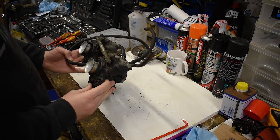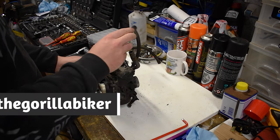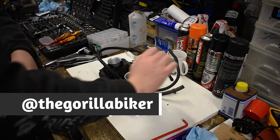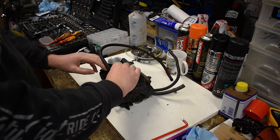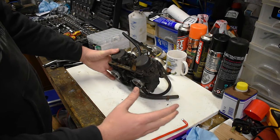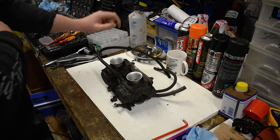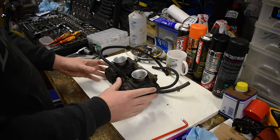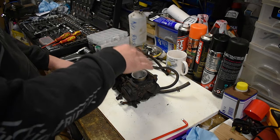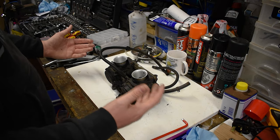Let's have a look at these carbs. There are a couple of coolant lines on this carb that I probably won't be putting back on. The reason I'm not going to put them back on is because they're not actually for cooling - even though they're connected to cooling lines, they're for heating the carbs to stop what's called icing. That's when you have ethanol-heavy fuel in cold weather and it ices up. I don't think that's going to be an issue here, so my plan is to just blank off that cooling line, which also means I can make the whole carb section look a lot cleaner.